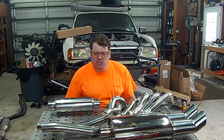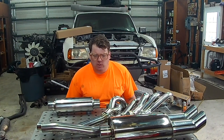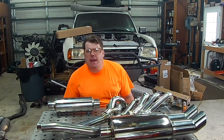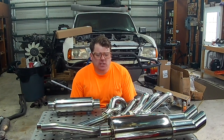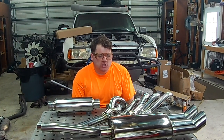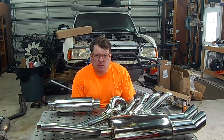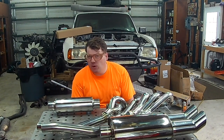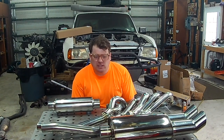So today's video is going to be the exhaust for the BMW. I was going to do just from the stock Y pipe back, but I had some issues with the nuts on the existing manifold, kind of sheared off the studs. So I was going to pull off the exhaust manifolds from the engine and just pull the studs out from there. And I just realized it's a lot of work just for no return at all.